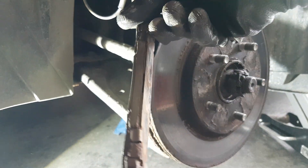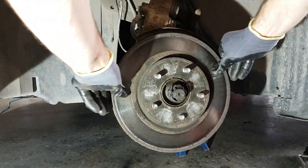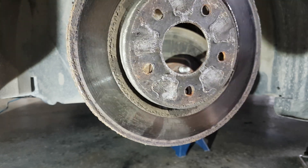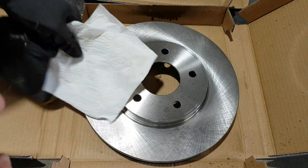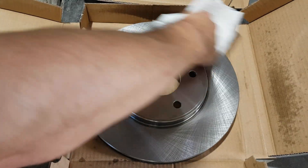Now I got it loose and you can see an example of very thin brake pads. Some other car models might have a phillips screw keeping the rotor in place, but on the Nissan Leaf it's just the wheel sandwiching the brake rotor on the hub. As you can see here, the brake pads weren't making good contact with the brake rotor anymore. If you're having a hard time removing the disc from the hub you might have to hammer it from behind, but then you can't really reuse that disc anymore because it's going to be slightly warped. Before installing a new rotor, make sure that you use brake parts cleaner to remove the oil, but you can also use a degreaser.